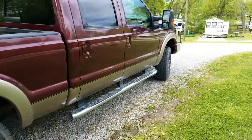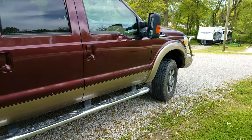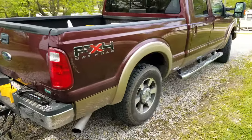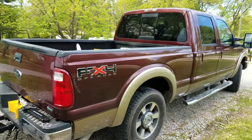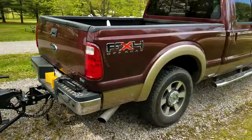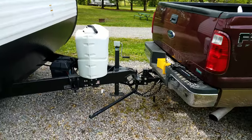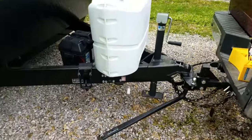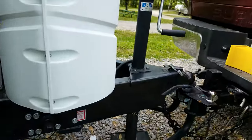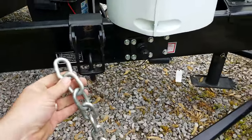There are specific ways to measure the front fender — how far off the ground you are before and after you hook up the trailer. My old truck here, this is Walter, a three-quarter ton Ford. Walter does not squat much whenever I put this trailer on him — it was built to haul and pull so it pretty well just sits there. That's why I've already got all my stuff set up. I know exactly how many links I need. There's one of these bars on both sides; I have the other one already hooked up.